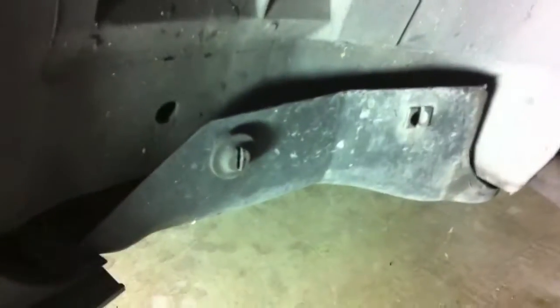I think I've got all the Torx screws off. I'm ready to start pulling and separating the liner. I think just pulling at it will do. It comes off like that. Looks like I've already lost some screws over there so this one isn't even holding on. I pull at this guy — looks like there are some important bits over there which I shouldn't break. And I think we have it. It's out.